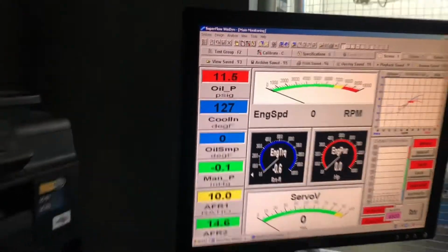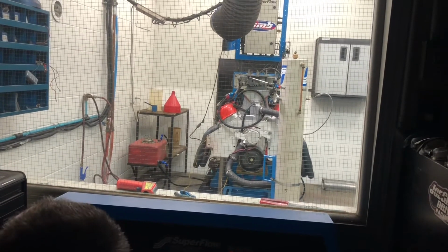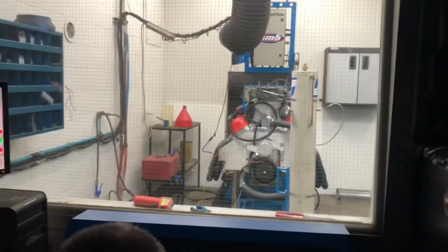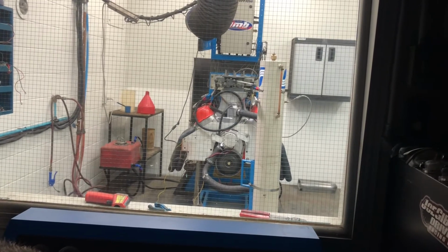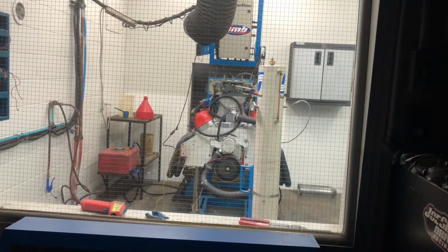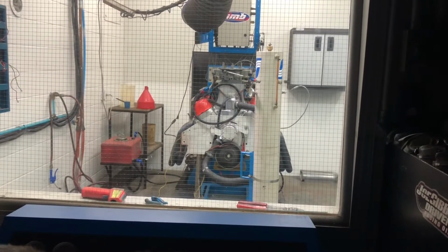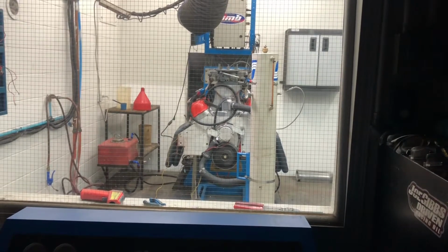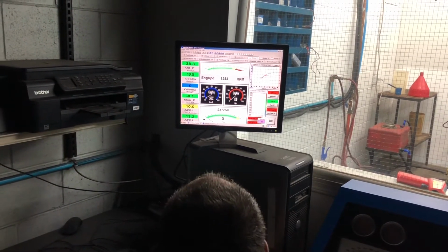Just hang on. It sure doesn't get very warm, does it? It's the thermocouple. But we've had some that get warmer than that. We know it's hot enough now, it's not going to beat itself up. I'm pretty confident in that RPM, and we got such a little timing in it, it's not going to beat itself up. Well, with that timing and not much jet, it definitely idles fatter after you beat on it. Yeah, it leans out after a bit.